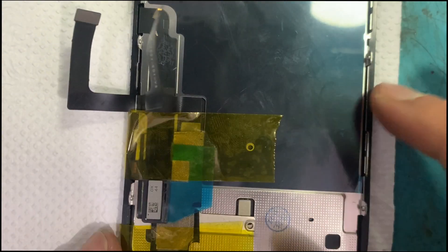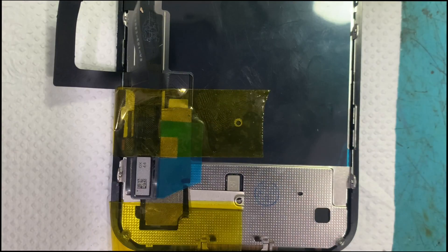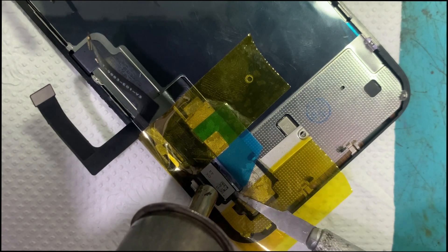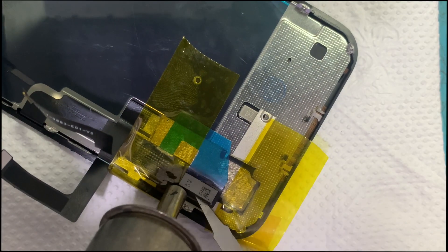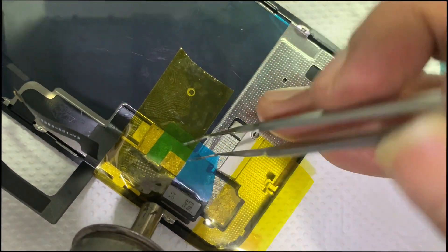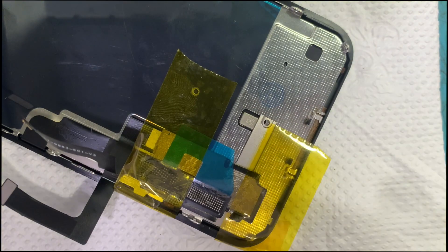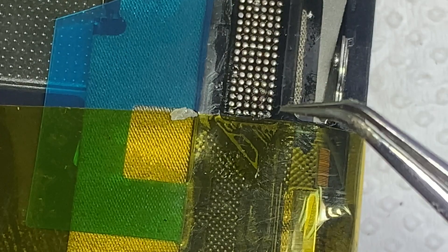On the new LCD, this chip is easy to remove. Heat at 120°C, airflow 10. Simple heat makes this chip come off. This chip is not soldered. Below you can see the resistor to bypass the True Tone system — this component is called the Torch IC2.